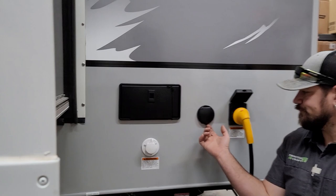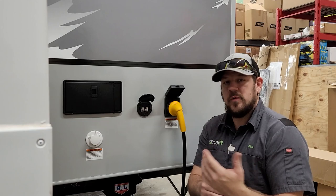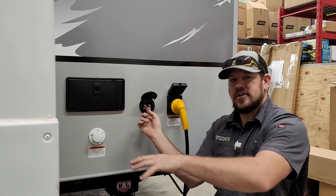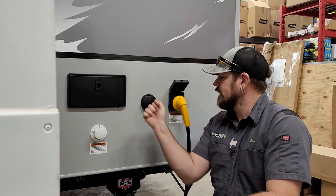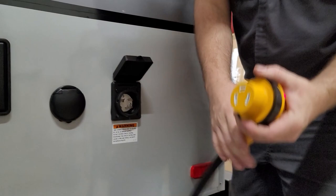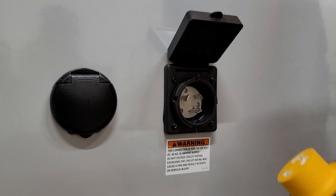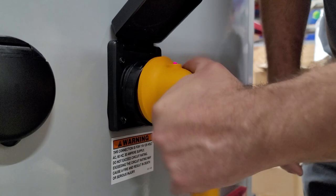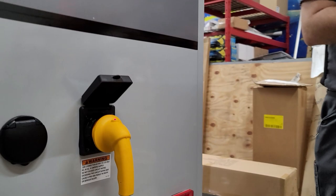There's a little black cap here — open it up and inside you'll find a satellite connection and a park cable connection. If you have a portable satellite dome, hook it up to the satellite port. If you're at a park with cable, use the park cable connection. Now for the 30-amp power connection — match up the L-shaped prongs, push on, give a little twist to the right for the initial lock, then tighten the plastic collar down to ensure a good, tight connection and prevent arcing or overheating.